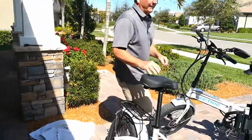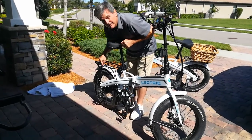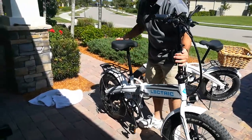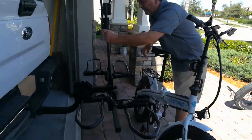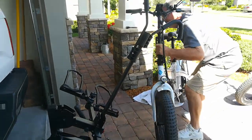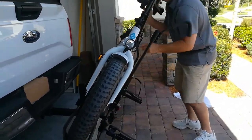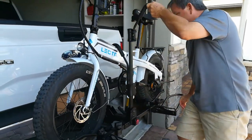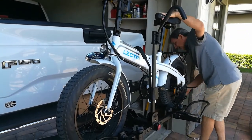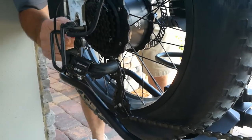I'm going to put the first bike on. When putting the bikes on, be sure it's in first gear so the derailleur won't hit the tire holding mechanism. For the back bike, you lean it forward. As you can see over here, in the lower gear the derailleur won't hit the bar, but if you put it in fifth gear it's going to hit the bar.